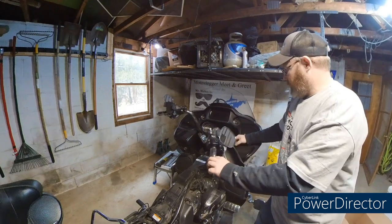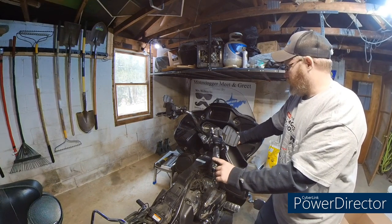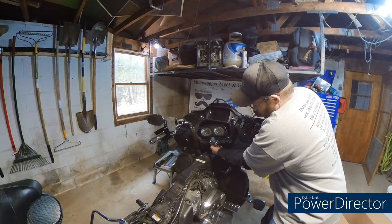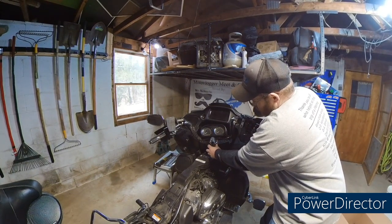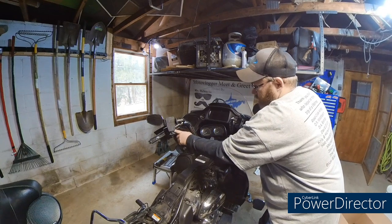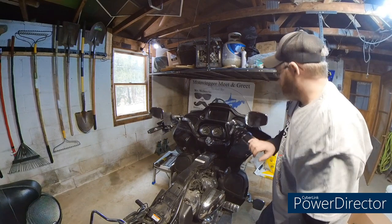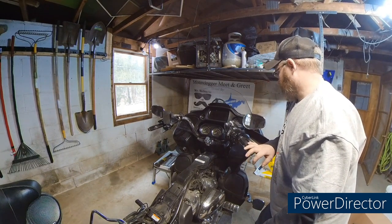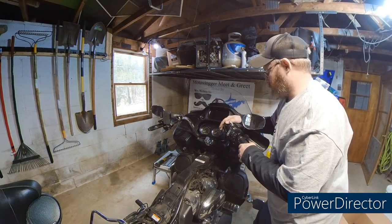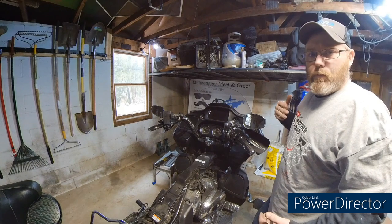What we're going to do is, you got a screw here on your instrument cluster, and you got one over here. You're going to take that off. You're going to take a pick up in here, pop that little tab, pull that out. You don't have to pull your ignition. I've got some zip ties here to cut for my cyber charger power. And then, what else? We'll get that off of there and get the brake and clutch master cylinders off. Unplug some wires in here and we should be off.